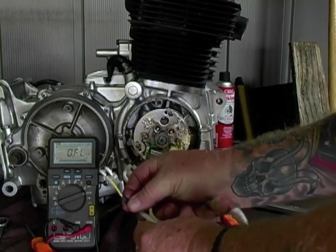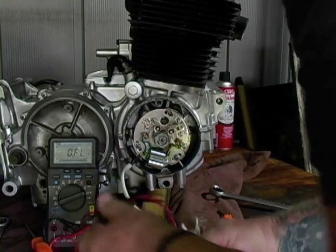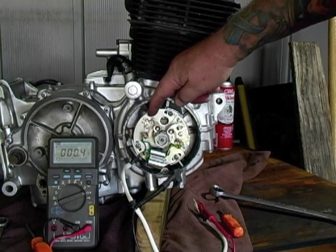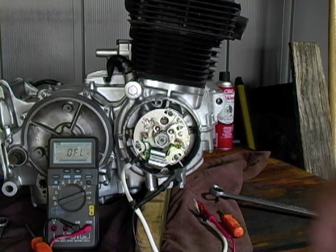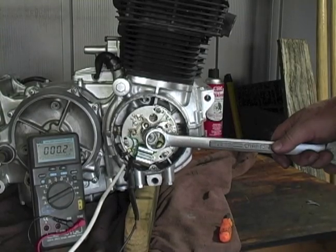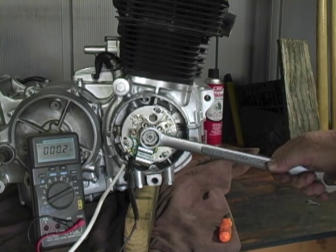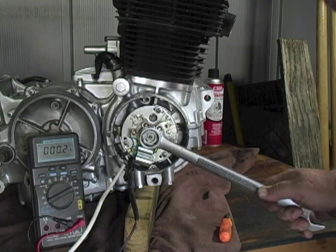See the blue wire here and the blue wire here — we're going to put that together. Right now I'm reading the resistance through the points. As I just opened it, it should just pop right there as I come up to the F mark. Now I have the F mark for cylinders 1 and 4 just prior to the index. We're going to bring it over really slow as we watch the gauge meter, looking for that change to happen just as I get to that line.